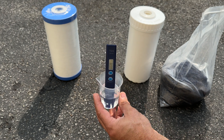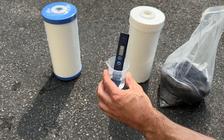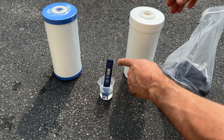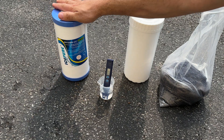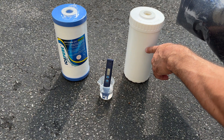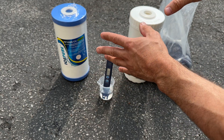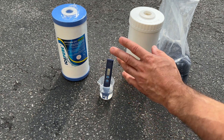So what I'm going to say about this video: check your TDS and try out the system. I like the combination of carbon filter and resin, but everybody's going to have different water, so try out what works best for you. I can't believe that after using this system all summer — washing cars, the driveway, sidewalk, garage — my TDS only went from 3 to 8. I am nowhere near needing to change these filters. The resin bag is still halfway full and I haven't needed the backup. I always wash in direct sun, no flash rust on brake rotors, no water spots. It works absolutely great.